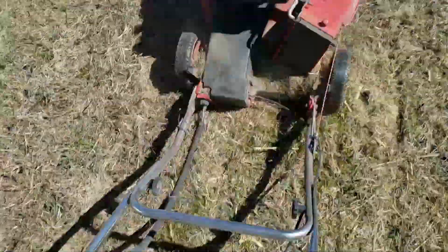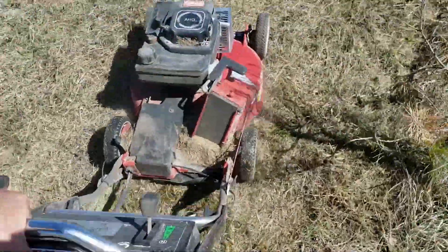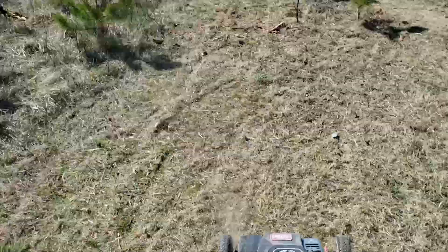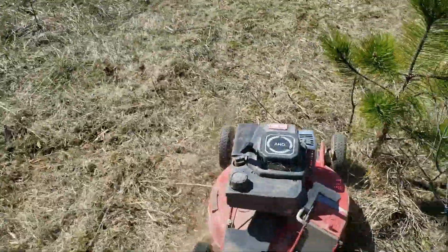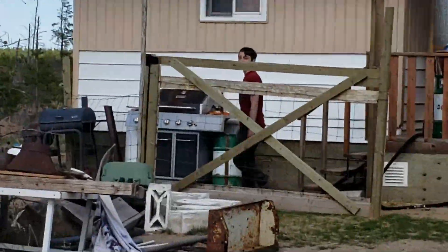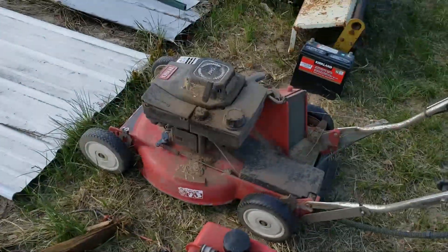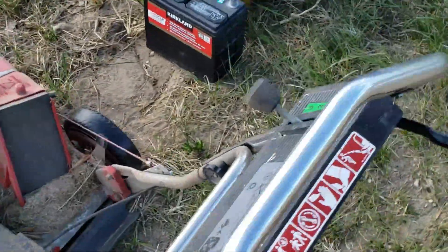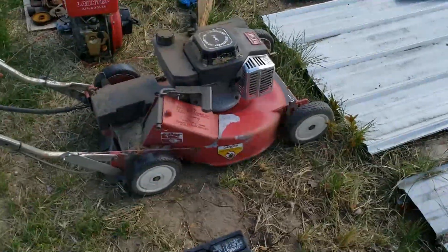Look at that — it's like gone. I just gave it a hell of a kick as you guys could tell. The oil fill cap popped off once but that's because the threads are gone — not much left of the bottom protector. Still has one crack on the side that's old, and I noticed the air filter needs to be replaced and cleaned — it's pretty plugged up. I took off the bag halfway through.